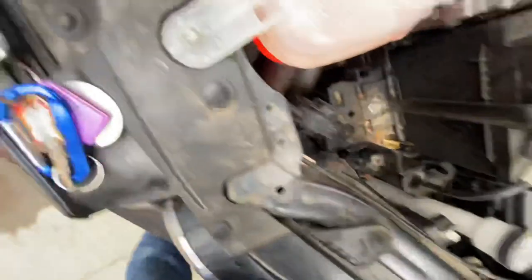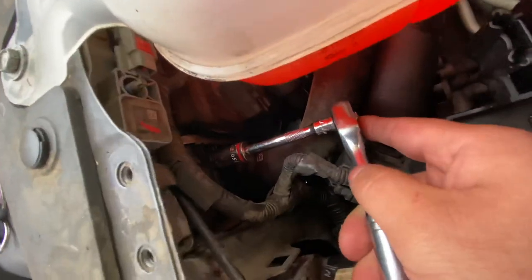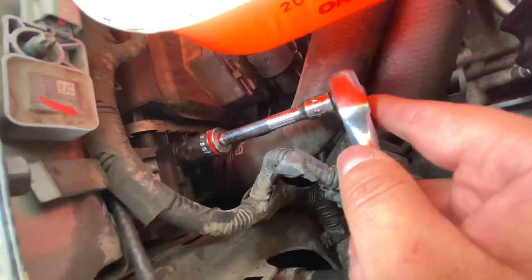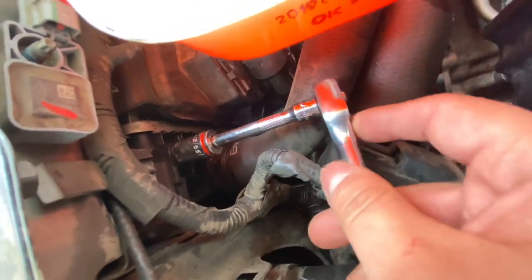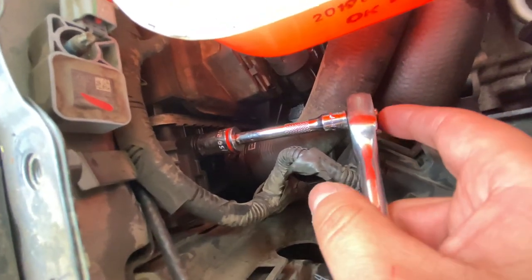You just take a 13 millimeter socket — it's a plastic thing. Just follow another YouTube video that covers bleeding the cooling system; I won't go into that here. But this is where you can find that screw in case you have an air bubble in your system.